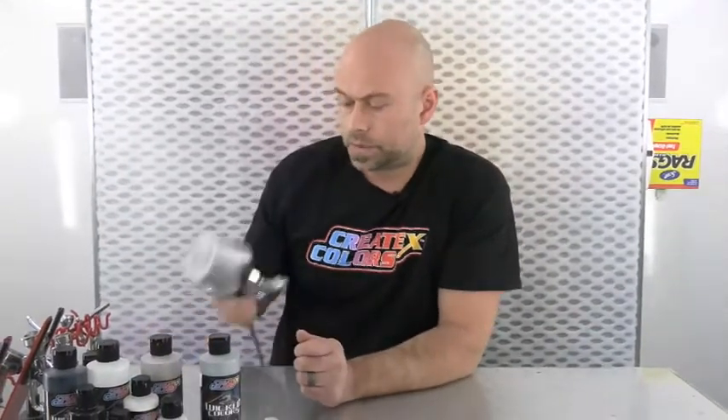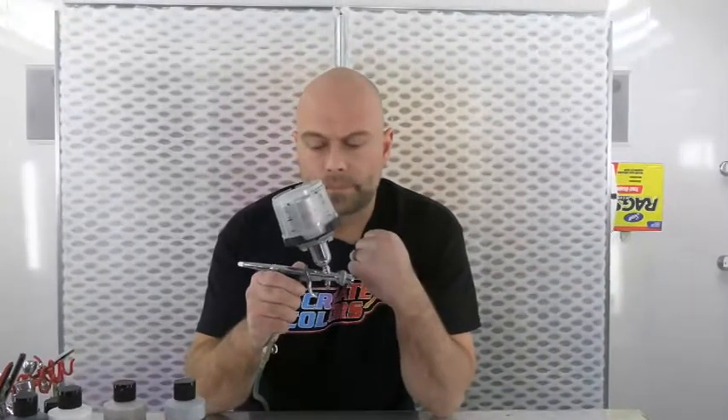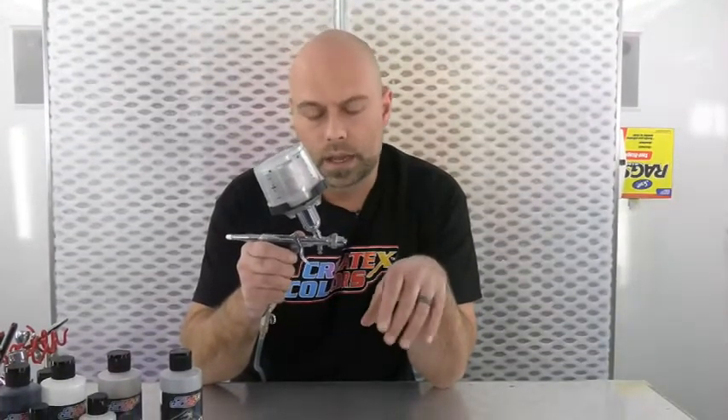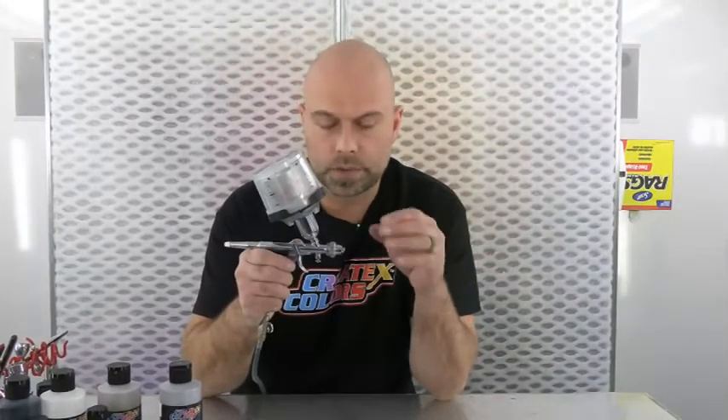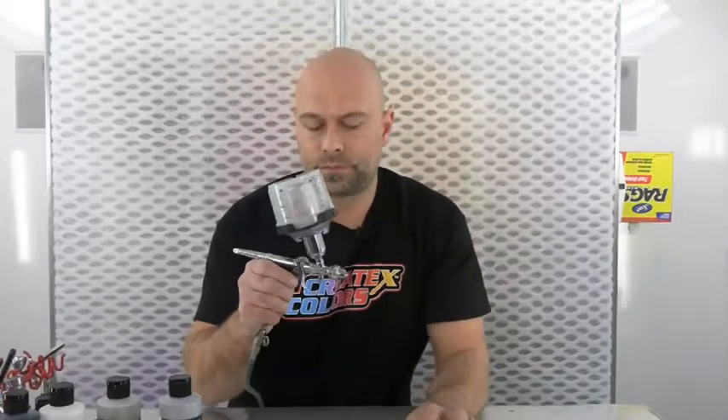For this we'll use the TH2 again, right around 45 psi, which is a little higher than I normally spray it. You want to be really mindful with your application technique. This product is designed to dry on contact, so give enough time between coats to really let it dehydrate and make sure it's dry. The last thing you want is a wet application, so really fine coats, building up probably four to five — four is kind of the sweet spot.